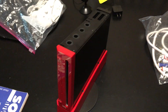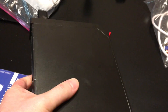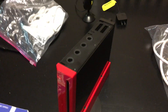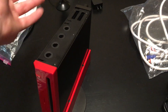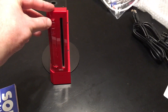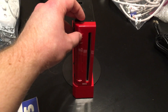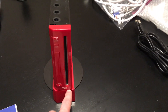What I had asked him to do was use the entirety of the XCM case, which is this third-party matte black case. He contacted me after installing the HDMI mod and said that the top ports didn't line up properly because of the manufacturing of that case. So I ultimately just didn't use them, because I like to have that GameCube stuff available anyway. On the front of it, the power button from the XCM case didn't work very well, which I had read about in some threads online. So I ended up putting the original red front panel back on, which I was also thinking about doing anyway just to get the Wii logo on the front.